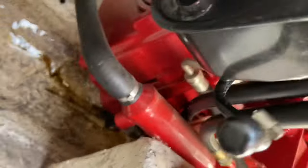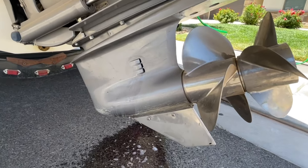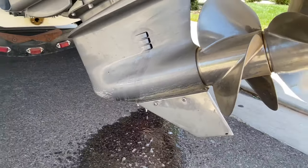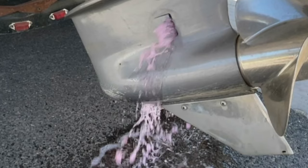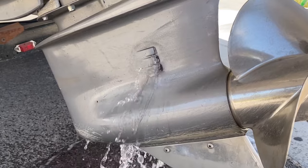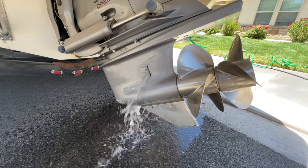It's also a very good idea to put some water down in there and make sure that the bilge pump works, because you want to definitely confirm that before going on the lake. When you turn the water on, keep in mind that when they winterize boats they usually fill the engine block with some marine antifreeze. It's not as toxic as automotive antifreeze, but it is still illegal to dump it in the lake, so you don't want it coming out unless you can collect it. As you can see here, as we turn the hose on you'll see that purple tint coming out — that's the coolant antifreeze they had put in. It cleared out pretty quick, but it would still be illegal to put the boat in the lake and just let it dump.